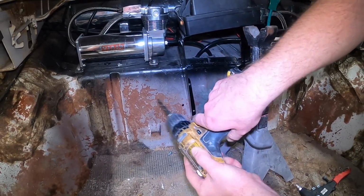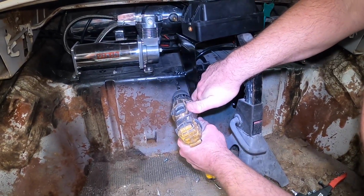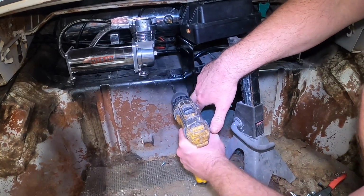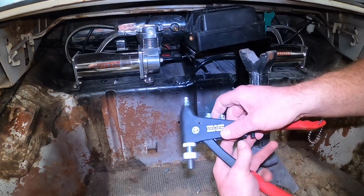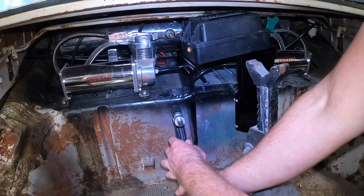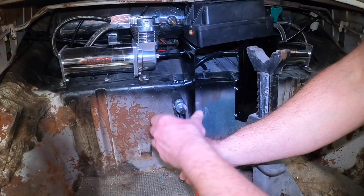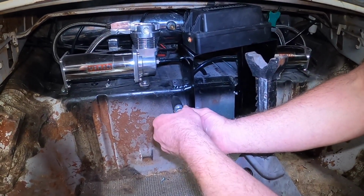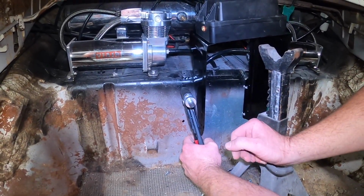Whew, got a sharp drill bit there. All right, holes drilled. Nutserts, they go in. Squeeze it, it pulls it in a little bit. Turn it in a little more. Get it where it wants to cooperate here. And you just squeeze it until it stops squeezing.